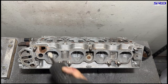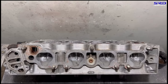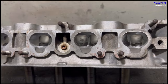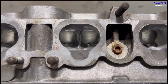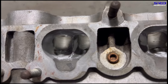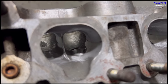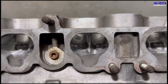Here you can see the current state of the ports. The bowl is blended but still rough — you can see it closer. The bowl is still rough but we're getting to the shape we're shooting for. You can see we've actually slightly equalized the core shift, and later on you'll see it's gotten better. Now we wash this up and go to the workbench to show you the current status before the final finish.